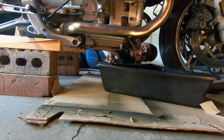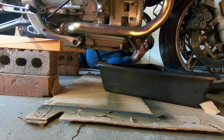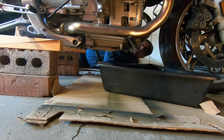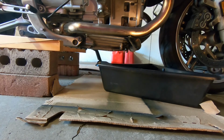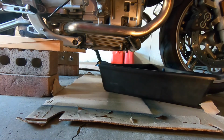Okay, so here we go. We got the 8mm hex, and we're torquing in that puppy, and we're waiting for it to break out, or whatever you call that, ratchet out, break out. Once it's a certain torque, it'll kind of pop. Oh, there we go, pop. That's all good. Everything's tightened up, torqued up. There's still no oil in the engine, so don't you go starting it.